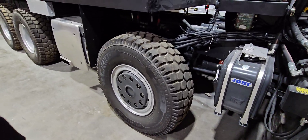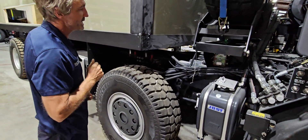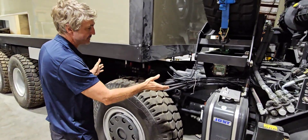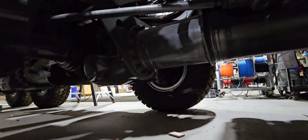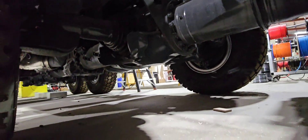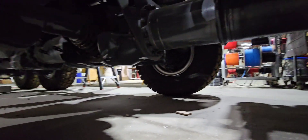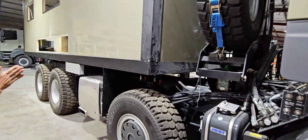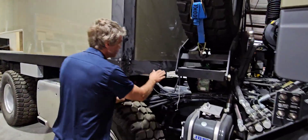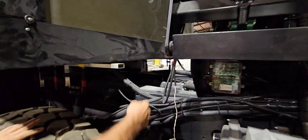Proprietary components — really the main parts of these Tatra trucks is down here in the chassis and driveline. Basically under here you can see they have different sections where they can add on a driveline, add on a set of axles. The axles come out and they're all independent. They have an airbag for each one of them. And then on top here we have two chassis rails, all triangulated into that driveline.